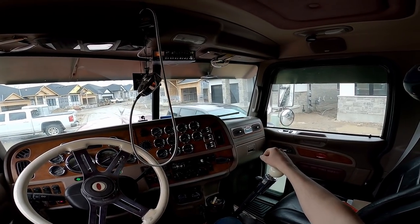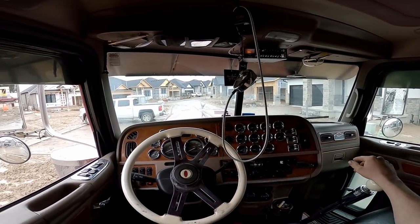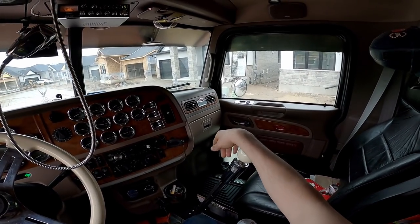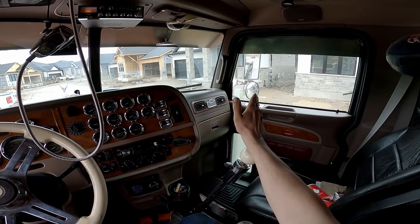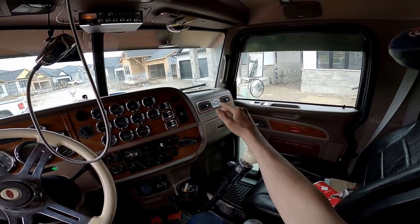And then there's a second lift axle on the pup that's slightly ahead of the rearmost two axles, and if I drop that, which is actually what I had to do to get around the corner that this van is about to drive around, then it should lift up the rear axles and let them drag around the corner slightly tighter.